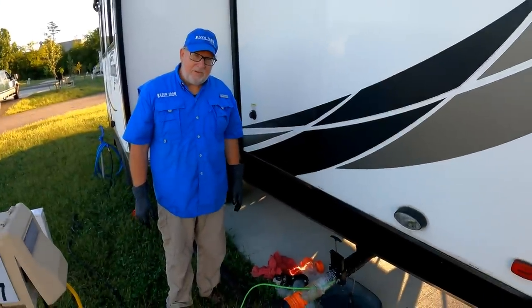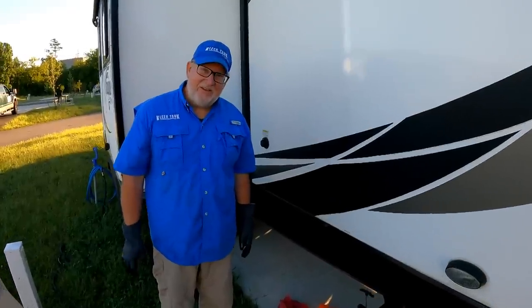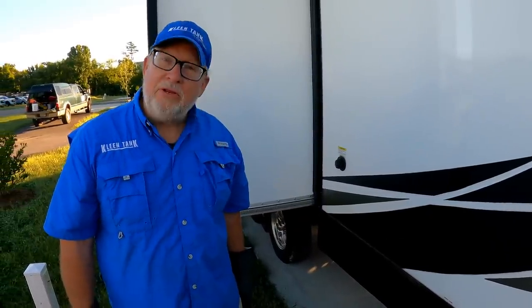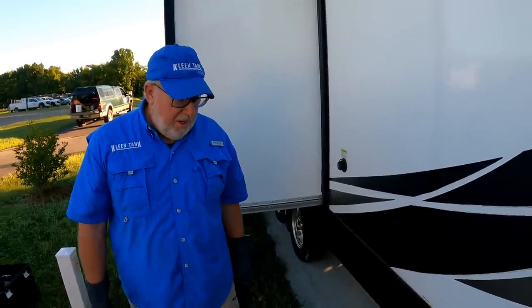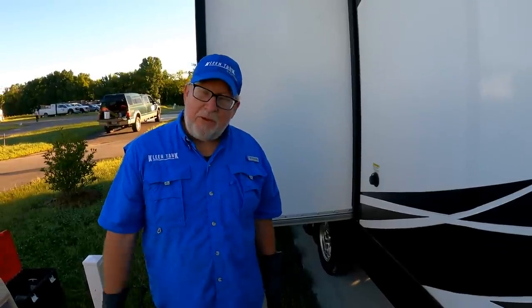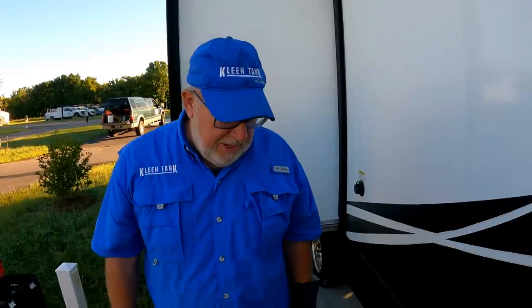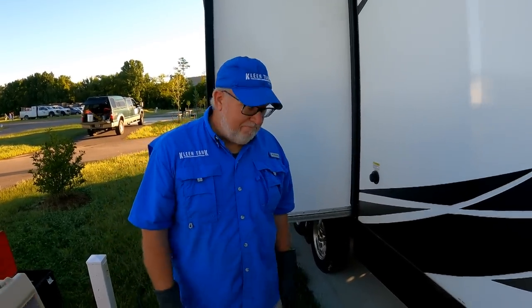Our tank looks fairly good, but there was a lot more that came out than I was expecting. Any additional tips? Just use a lot of water — that's the most important thing in any of your tanks. I'm about to do the bath gray tank, which will be pretty clean — there's a lot of water that moves through there. After that we'll move up to the front of the rig where the galley gray tank is, which is always the worst. Gray tanks always have a lot of mold because it's a hot, wet environment where mold spores float around.